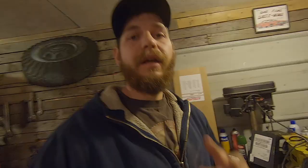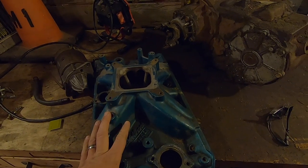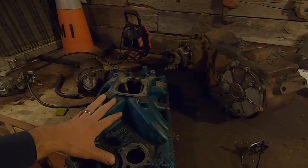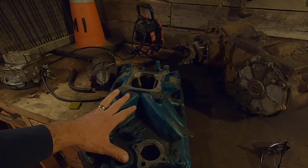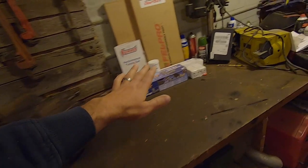And I've got my gaskets. One of my subscribers, whom I consider a friend, gifted me an intake. Got an Edelbrock Torker II aluminum intake for the AMC motor. This is kind of what changed my whole decision — yeah, I should keep it AMC. It's not gonna be the perfect intake for off-idle and stuff, but it should be fun. It'll match up with this cam really well. I'll go with a smaller carburetor, like 600 CFM max. Hopefully it'll still be pretty streetable, and with my doubler setup and the 4.56 gears I should be in that high RPM most of the time anyway.